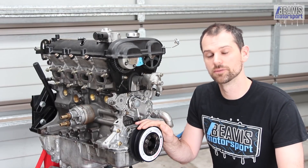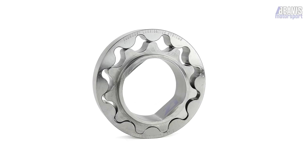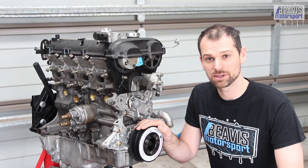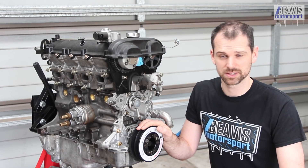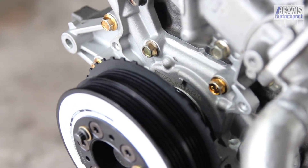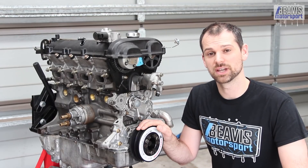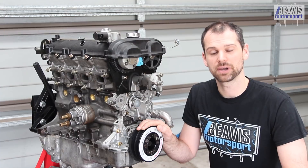The VVT version runs oversized gears for improved reliability, a stronger pump again, and you can option in more shims for increased peak oil pressure. Each shim adds approximately 6 psi to that pressure. Most people run between 1 and 3 shims — it depends on who supplies your pump, what sort of engine you're building, and your engine application. In my case I've gone with 1 shim, as recommended by TrackSpeed Engineering.